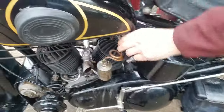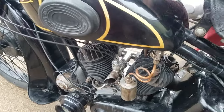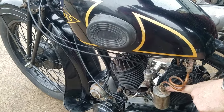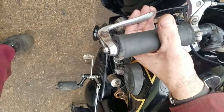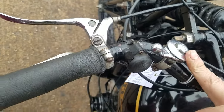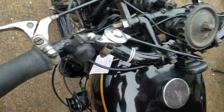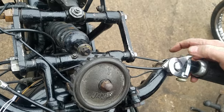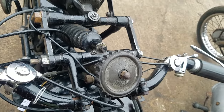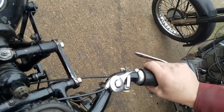And then the fuel tap on the other side — hex is on. Give it a bit of a tickle up. Then up on the controls: valve lifter — the one that always catches you out, you think it's a clutch. That's the clutch. Ignition advance and retard — it's a tight wire advance, so it's fully advanced. Choke — that's open and that's shut. With your nice internal pull throttle.